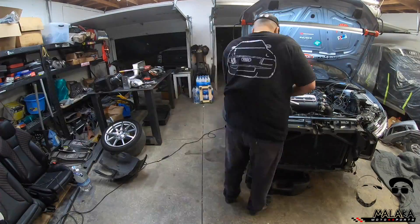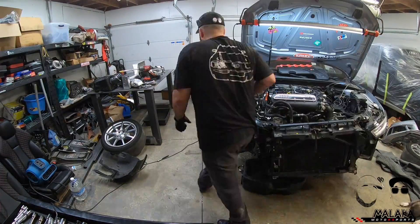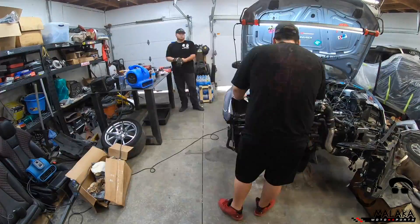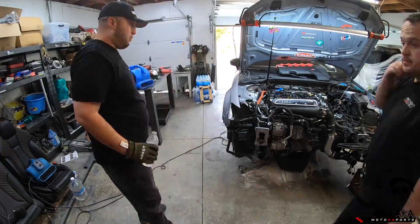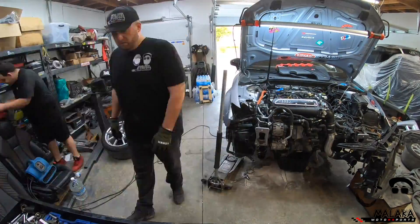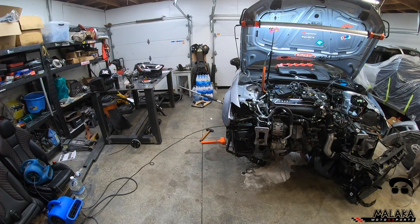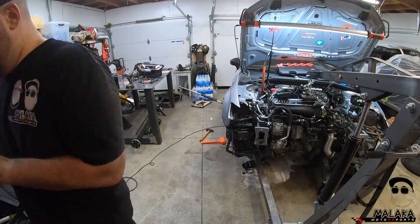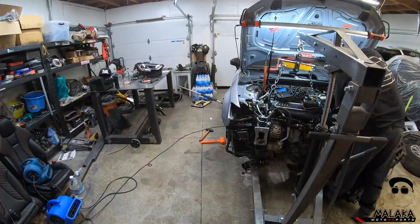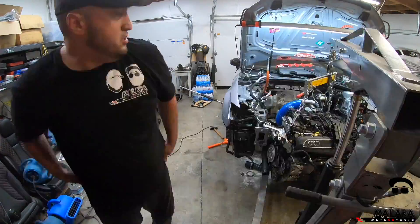Being that the car is very new and very expensive, I'm trying to be as careful as I can, as the intention is to put a stock motor back in after the built motor is out. Stop was going to come help with the drive shaft and axles — he came over briefly but had to leave, so I ended up pulling the drive shaft myself. Using a small box on the edge to hold it up — as long as you don't let that drive shaft come apart, you're good. I used my Harbor Freight engine hoist with a leveler and slowly nudged the motor out, being careful of the AC line and the down pipe against the heat shield.